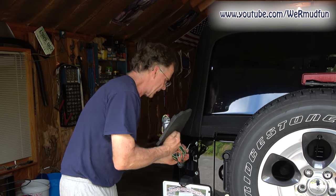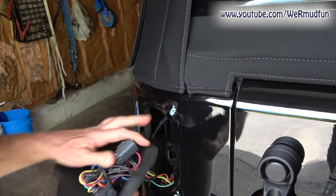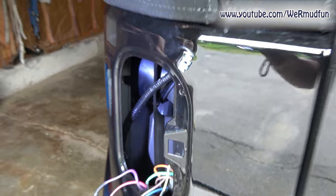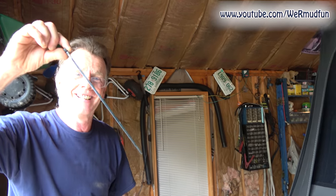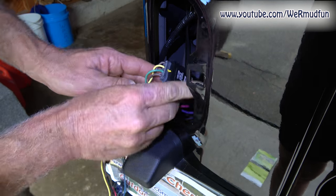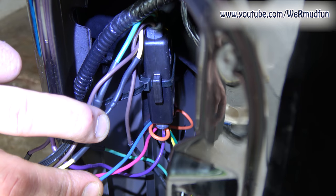I'm going to fish this through and push it down into the hole. We're going to end up strapping this diode converter right to this piece of metal here. The zip ties that they give you look a little small, so I'm going to use my own. That's how we're going to strap it around that piece of metal — it has nice little handles to put the zip tie right through. Now it's zip tied on there, it's not going anywhere.